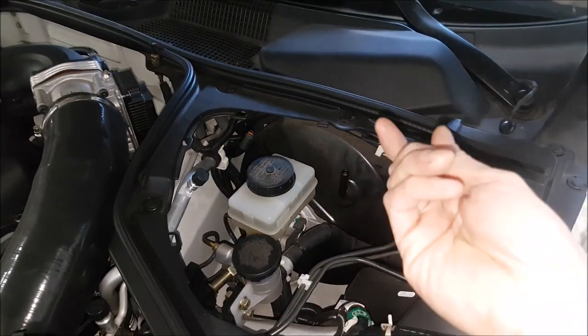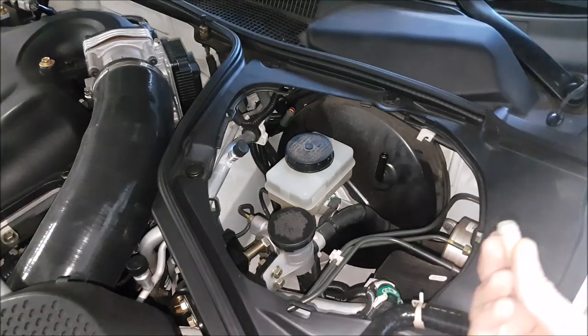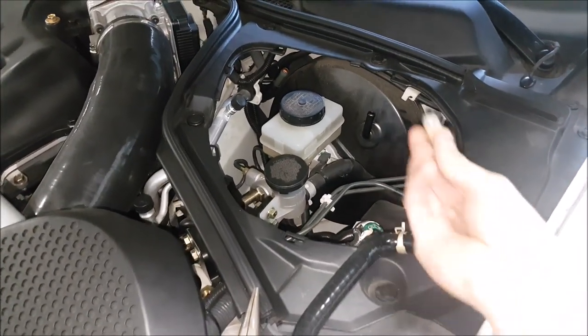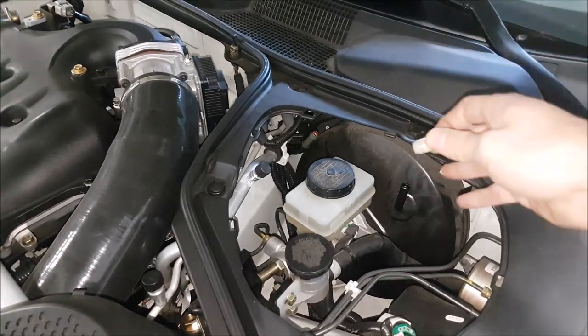Remember, the engine is creating vacuum, so it's sucking out — our airflow has to go towards the engine. Figure out the orientation it has to go in. We figure out this way it's tapered, so we're going to go in on this end of the vacuum tube, facing this way. That way the engine can create vacuum, but when the engine's off, we keep the vacuum going in our brake booster.